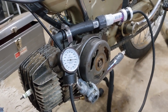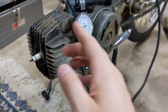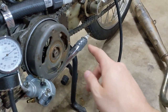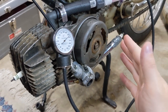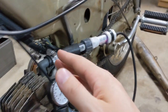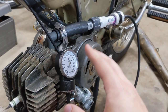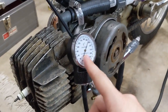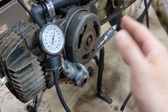I think at this point I've hosed down every single junction on this tool, all the way from the squeezy bulb to that fitting and back to the front, and every mating surface I can reach — spark plug, head gasket, base gasket, the intake again. I even sprayed the little spark plug on the end, even though that JB Weld is solid. No bubbles that I can see. The next step would be to test the stator side crank seal. I'm not going to right now — that's a suspect for a leak. You can't actually access the clutch side on an E50 because there's a bearing in the way. For me, this is just a stock beat-around bike, and it's still really great to learn which air leaks you can fix and then decide if you want to justify going any further.